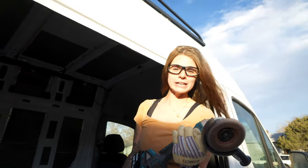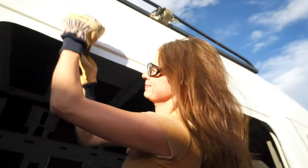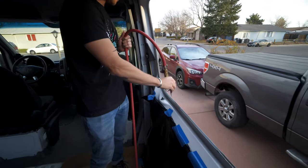Once your hole's cut, you're going to need to come back through and clean up all of your edges. You don't want any crazy spiky burrs that are going to catch and cut you. We're going through and hitting any high spots with a grinding wheel, and then using the file to brush off any of the burrs — a 40 grit sanding wheel. You're supposed to move the file in one direction the entire time; just go in one forward direction, pick it up, and then start back and go forward again. I came back through and sanded it all down with the 40 grit grinding wheel and that cleaned it all up. It's also a good idea to blow out any metal shards that may have fallen within the cracks and grooves in the van — you don't want moisture and condensation getting in and causing rust later.